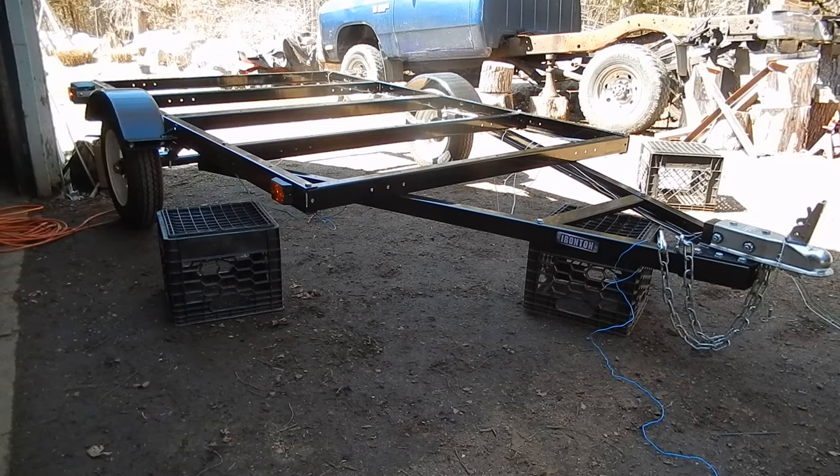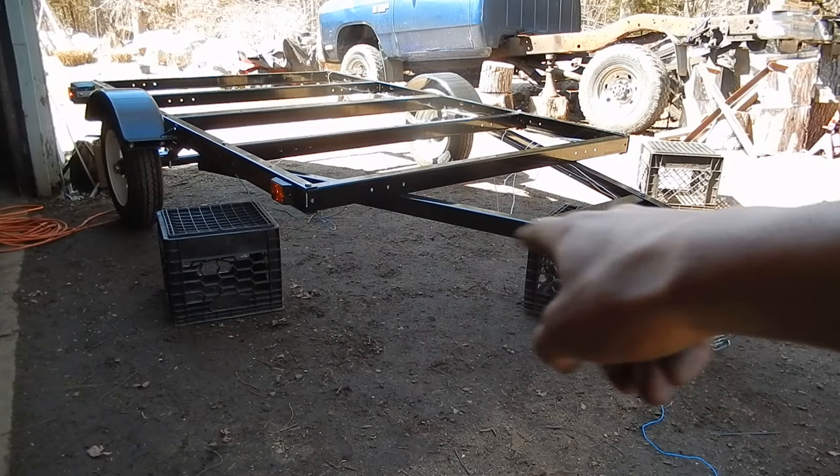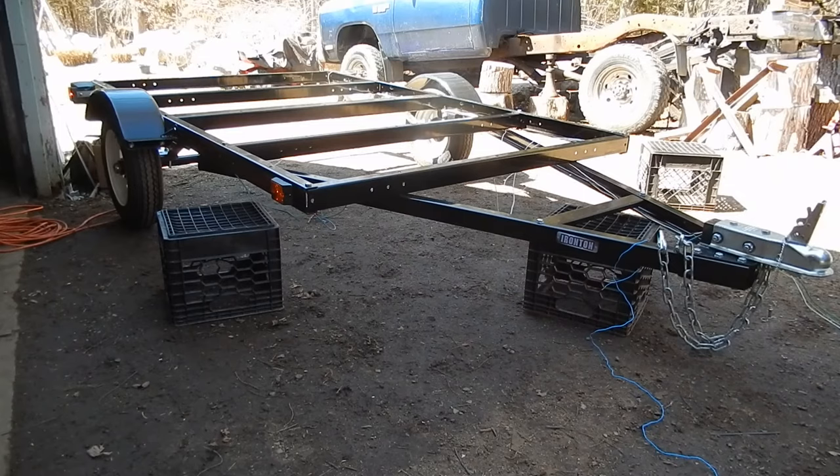So I fixed all those connection issues. And the ground issue was also a big problem. They made no mention of that in the instructions. At least not that I saw. Maybe I missed it, but I highly doubt it. But it just stands to reason. I mean, that joint there is paint to paint, and then it's paint to paint there, and all the connections are insulated with paint. So it's a miracle that that one light over there worked. So that wasn't a big deal, just a little bit of troubleshooting.